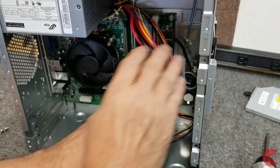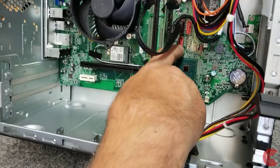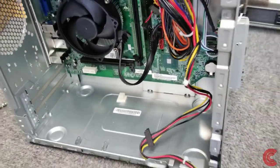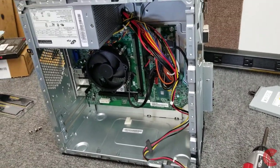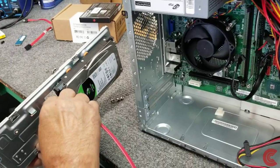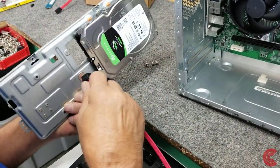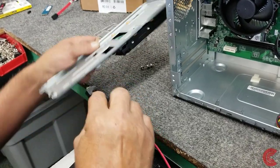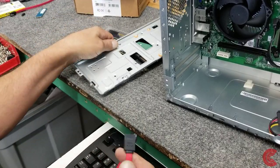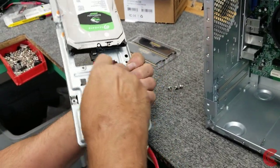Before I get in there, I've got two extra SATA ports here. I'm going to go with this SATA port right here for the 3.5-inch drive. I've got two cables — an L-connector here. Actually, maybe not — I'm going to use the other one. So now I'm going to take out this 8GB stick that's in here. There's just one clip on the top; the other one on the bottom is stationary.